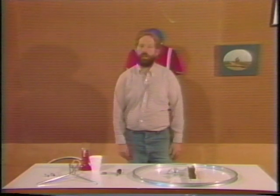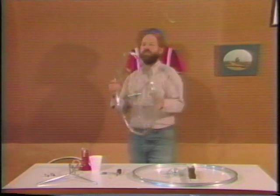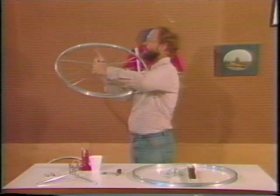Now, our object in building a wheel is to do it in such a manner that it will require the minimum spoke manipulation to insert the spokes. Second, the pattern will be such that the valve hole will fall between a parallel run of spokes like this. Do you see the valve hole? We want to make sure that you can easily access the valve with an air hose after you've finished your wheel.